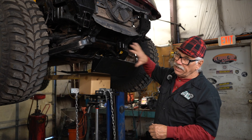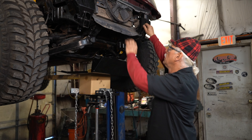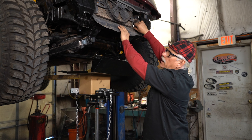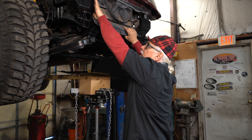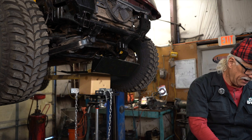This particular one has AC, so first thing we're going to do is just get this out of the way. I'm going to take off the windshield deflector - it blows the wind up into the condenser for the AC. You see how easy that comes out - two bolts - we'll put that back in a minute.